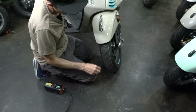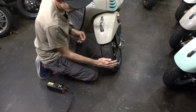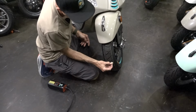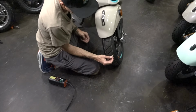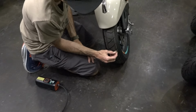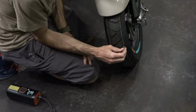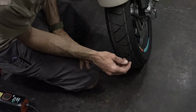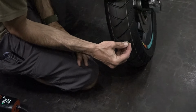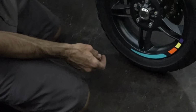But more important, you want to check the tread. On the front tire, they tend to wear kind of unevenly. They'll have a cupping sometimes, which does affect the handling. The general rule of thumb is that the top of the penny to the head is about 1/16 of an inch, or around a millimeter, and that's about as thin as the tread you want to have. So once you can see the penny head, when it looks like that, then it's definitely time to replace the tires. Maybe even sooner on a front tire is my instinct.